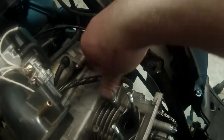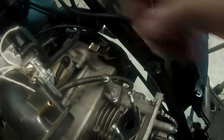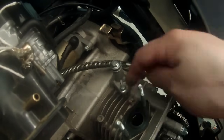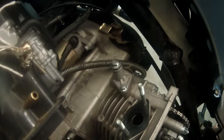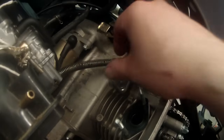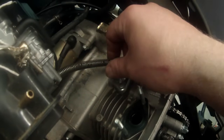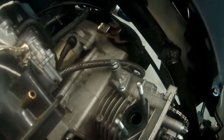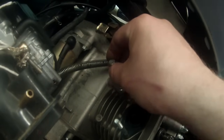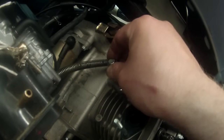Cracked, it has. All right, so here's why I'm doing that. All you have to do is take off these two bolts, and then your tension is released. But if you wait to crack this bolt until it's already off of the motor, then it's very hard to hold that tiny piece and crack something that's pretty tight from the factory. So I like to crack it right away.